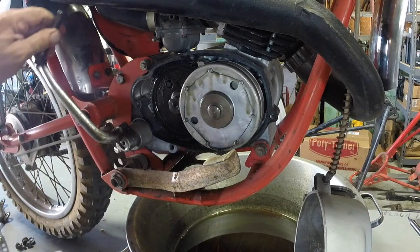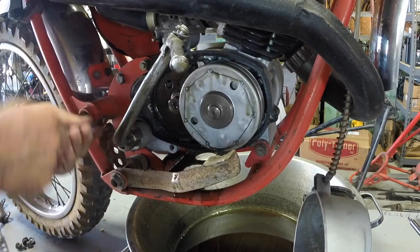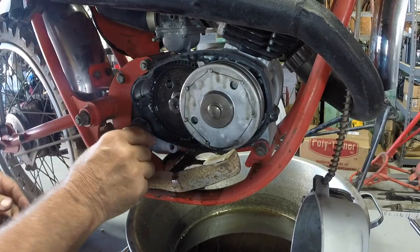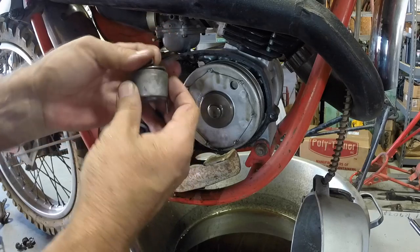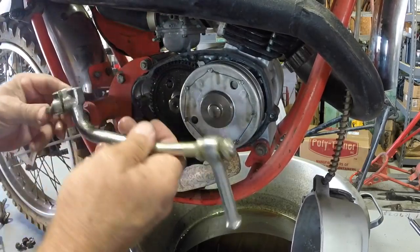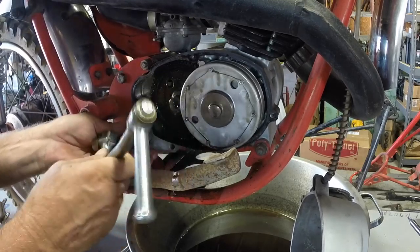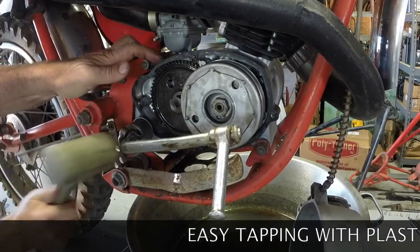The reason it's necessary to take the case off when you replace your Kickstarter is this mechanism will spring all the way forward. There's a little hole right there that this spring goes into — this is the spring cover, it's going to go in there. Now see where this spring is indexed. When you put the Kickstarter on, you need to get it into this hole, so your Kickstarter is going to be way in this position — you got to get it on and rotate it around.